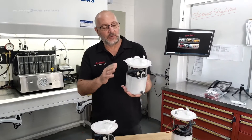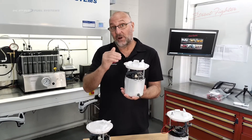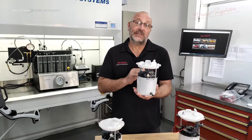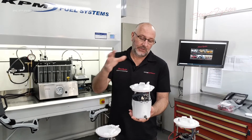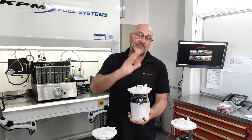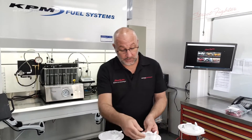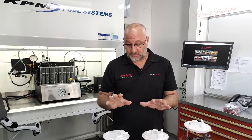Moving to our 1,000 horsepower module - again, still a single pump, but a massive pump able to supply 1,000 horsepower at the engine on petrol. Again, 100% ethanol compatible. Pull your tank out, take out your standard module, put in the Street Fighter 1,000 horsepower module, refit your tank, and nothing else to do. It's an absolute direct fit - the standard wiring loom clicks straight onto the plugs and the standard fuel lines click straight on.